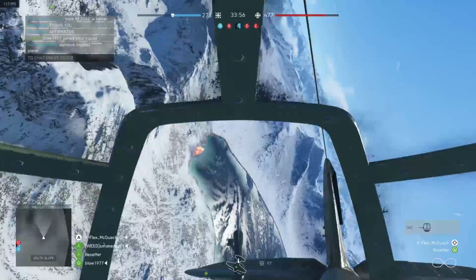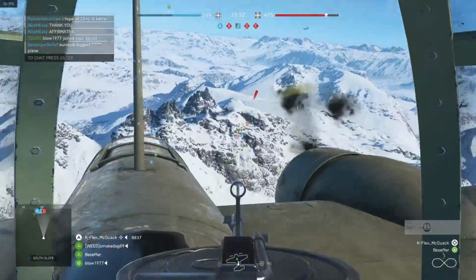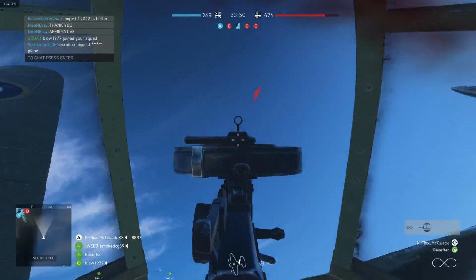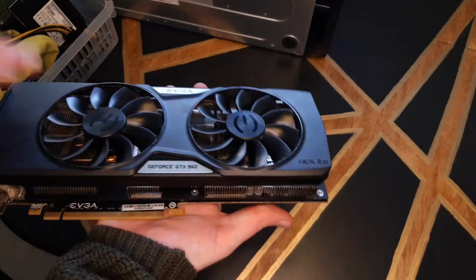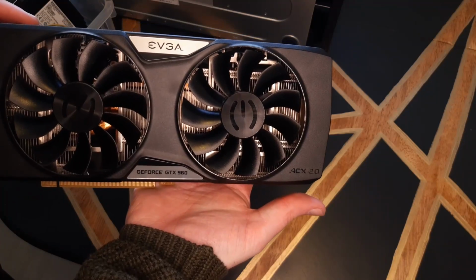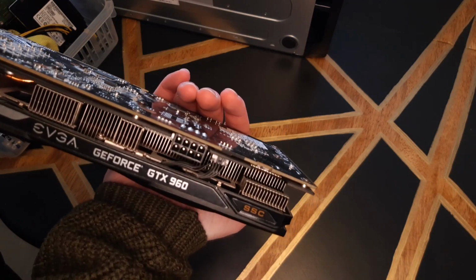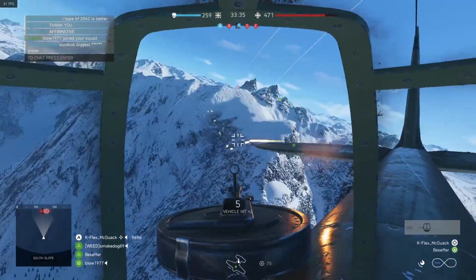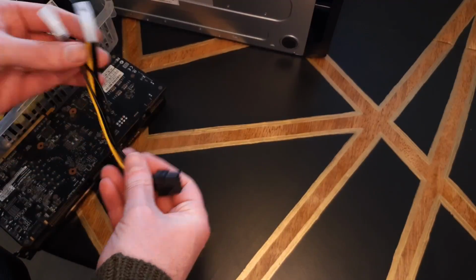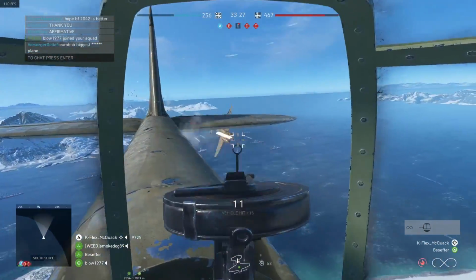Now obviously this thing is going to need some kind of graphics card, which I don't have a lot of at the moment. I don't think anyone really does anywhere. I'm always torn between what graphics card to pair with each processor I get, but ultimately I have decided to use the best spare one I have, a 2GB GTX 960, which I picked up for £63 in a recent deal. The PSU doesn't have the right connectors for this, so for testing purposes I'm going to be rocking a 2 Molex to 8 pin adapter. I have no clue how this will pan out, but I'll trade the power supply out for a new one if I really have to.